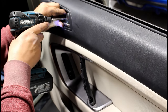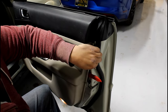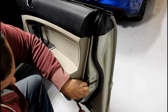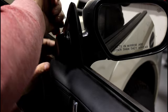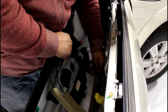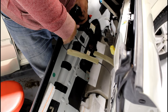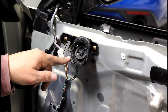You've got three screws — one in the door handle up here, one here, and one here. Go around with a panel popper and make sure every plastic clip is unpopped. Also pop this little black piece off — work it nice, you don't want to break it. Undo all the electrical: undo this one, undo this one, there's one all the way on the bottom for the door light, then open this and pull these two cables loose. Find the groove and they'll pop right out.